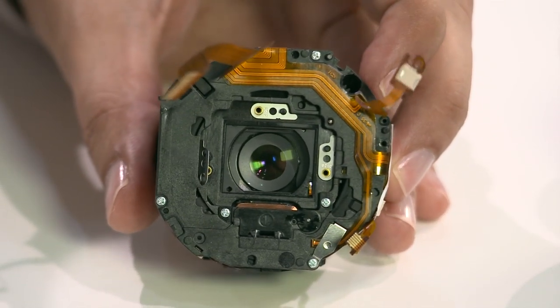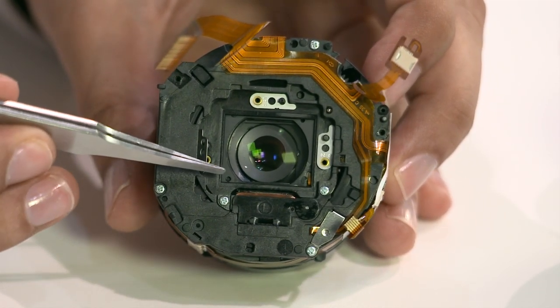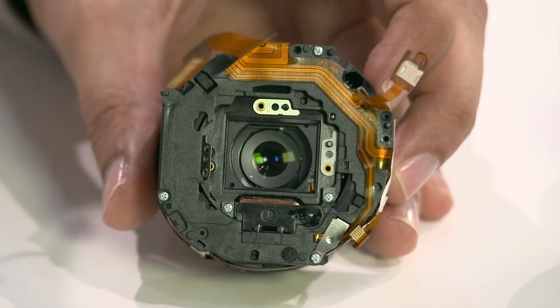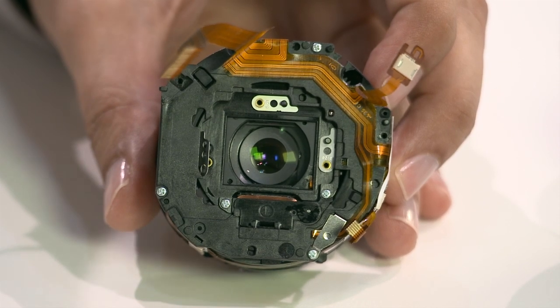Surrounding the lens are 3 washers along the top, left and right sides. The washers surround the image sensor to keep the light evenly distributed and properly aligned. Below the lens features a gold ribbon, which is the Optical SteadyShot image stabilization function, featuring a metal object controlled through magnetic pieces. There are a couple of different kinds of screws in the assembly.